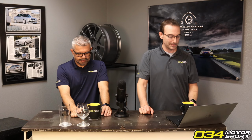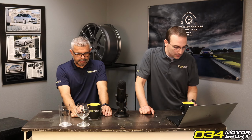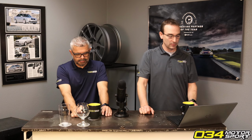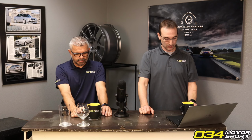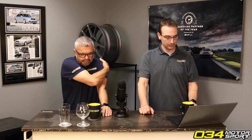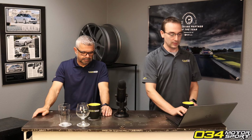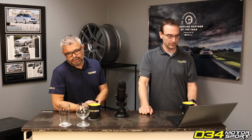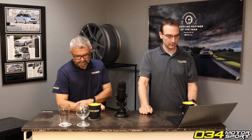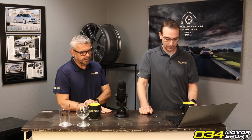Someone says, I don't know about this, but they say there's been a string of failures for the GESI high-flow cats on B8, B8.5, and now B9 3.0T as of this morning. That makes me think there's one that's failed. Do you agree that moving the cats under the car is the best solution for this issue? No, I don't agree with that. The B8's been tough to keep cats on just because of the temperature there. The B9, we've seen much less of that. We've sold quite a few of our B9 3.0T high-flow cats. No issues or failures that I'm aware of.